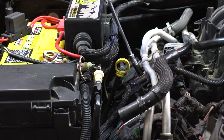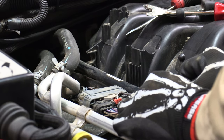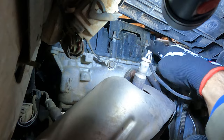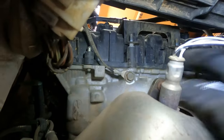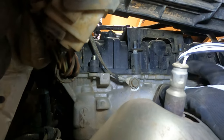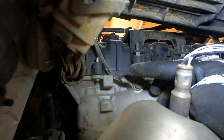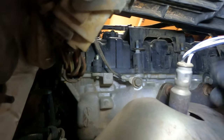I'm going to remove the bracket on the passenger side just to make my life easier when we eventually want to get to coil packs and spark plugs. There are two sneaky 10-millimeter nuts that can be reached from the inside wheel well. One more thing to do while you're down here is to look at your valve cover gasket to see if there's any really awful leaks — and thank goodness, knock on exhaust header, that looks good.